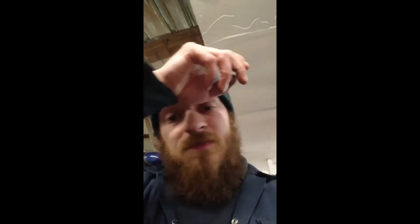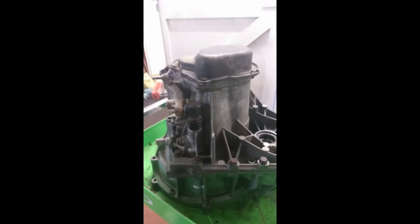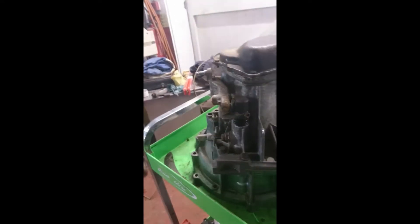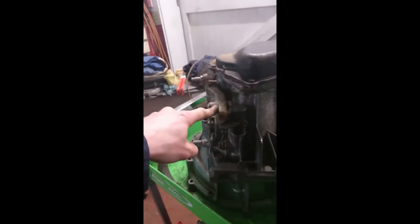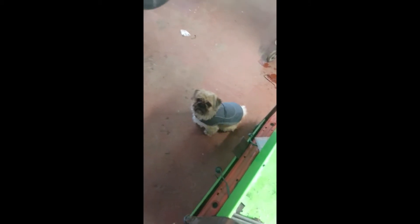Today I'm going to strip the box I got off one of my friends, which is a fully rebuilt one-to-five box — or so he says, I haven't actually stripped the internals and checked it. But I know it's got a Quaife diff in it, which is the reason why I got it. It's a rebuilt box. It looks a bit scruffy because it was going to go in a rally car, so it didn't need to look nice. It's got the cable shifting mechanism on this one, and obviously going in the Mark Five I'd have mine with the rods, which is not ideal, but I'm planning on converting to this one day.